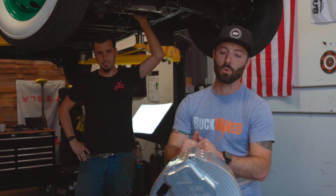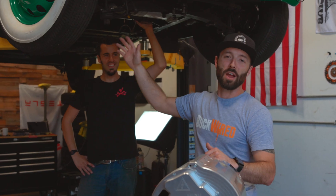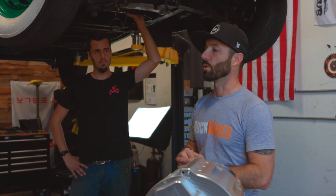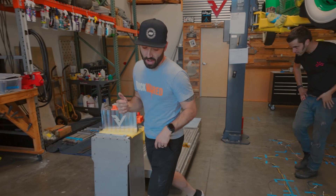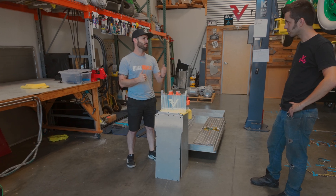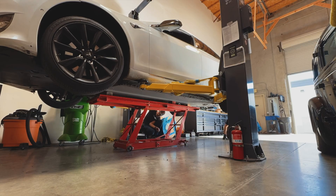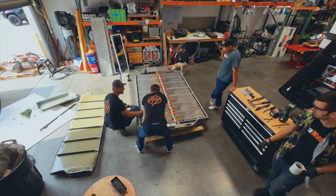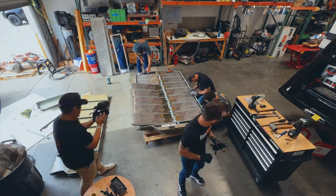This made a lot of things possible as far as using more of the engine bay space. It's going to be front wheel drive, so we're able to throw some batteries in the rear without having to fit a drive shaft down the center or fitting a drive unit in between the rear wheels — we were able to dedicate that space toward the heavy batteries to keep the center of gravity low. We spent some time in Fusion 360 and determined we'd be good with a 14-module setup from a 75 kilowatt-hour pack — part of a triple swap of a battery pack going from one Tesla to the next.